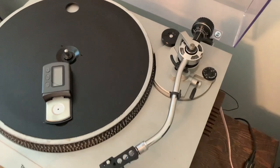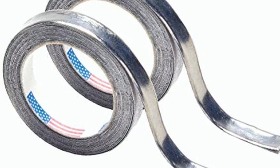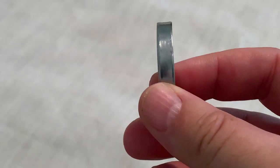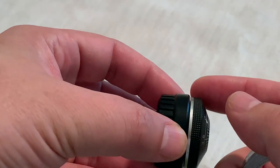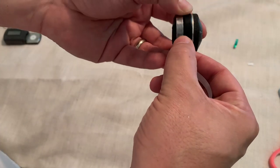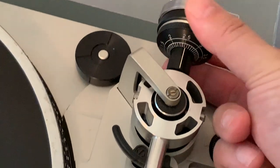So what do you do if you want to use a phono cartridge that's a bit too heavy for your tone arm? Obviously I must add extra weight to the counterweight — but how? I did a little internet research and found a posting that suggested attaching some lead tape to the counterweight — the type that is stuck to the frame of a tennis racket. I got the quarter-inch wide tape and I'm going to wrap it around part of the counterweight. It required some trial and error and I ended up attaching about four feet or 1.3 meters to the back of the counterweight. The silver metallic ring doesn't look too horrible — it kind of blends in. Now it can easily balance the tone arm with this Shure cartridge, and the counterweight is no longer precariously positioned like before.